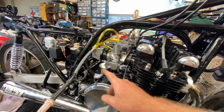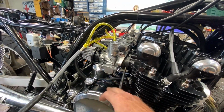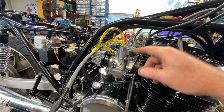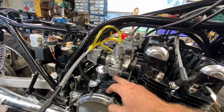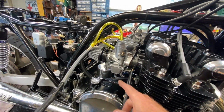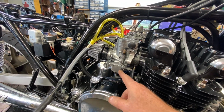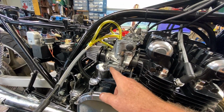And then I didn't do anything with the float levels. These are typical antique, ancient, from the last century, obviously, Kawasaki carburetors that don't use a measured float level. You use a service fuel level. So before I took them off camera after the last clip before this one, I did hook a clear tube up to number 4 here, since it's so accessible, and run it around the side, and then put fuel to it again, and it was dead nuts on.